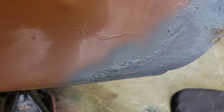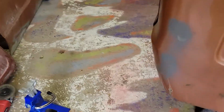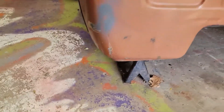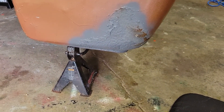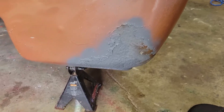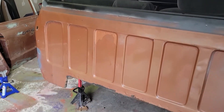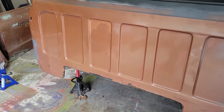Unfortunately this is a part of these trucks. For the most part this isn't so bad — it looks like this has been fiberglass back here actually. But I ain't too worried about it. This is going to be my truck — I'm not interested in selling it for a long time. This actually is really nice, but you can tell this corner was either rusted a little extra or had a hole in it. I'm going to use this time to clean this up, get all this loose paint off, and put a coat of primer on it.